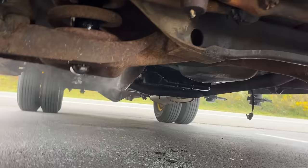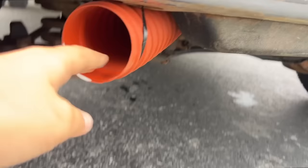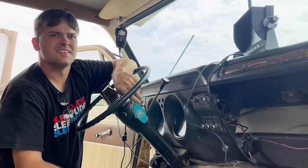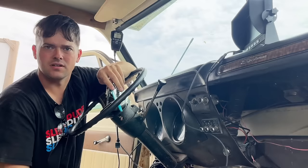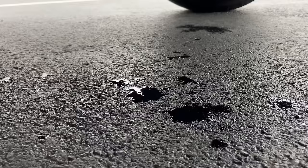Yeah, we're definitely still dripping oil, coming off the back of the oil pan here. It's getting on our exhaust. Pull your engine. We've got a leak to address, don't we? Yeah. Is our transmission fan running? Yeah. It's a B&M transmission cooler. It's set up on a temperature controlled switch, so anytime it's above 170, it kicks on. So it's working. Yeah, we've got a pretty bad leak.